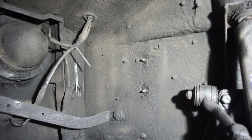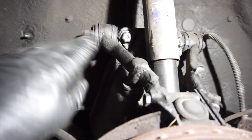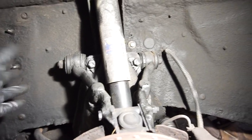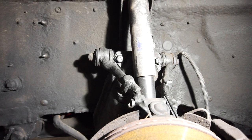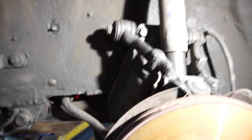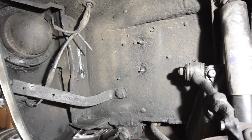It's about two hours later. I'd say it's cured — that's the right word, this stuff doesn't fully dry but it cures — so we're ready for the next coat. Everything's been sprayed in here and I've done the whole rest of the car as well. I also decided to hit some of the front suspension areas just to make it look a bit nicer. At some point I'll probably have to replace all the rubbers, take the whole front suspension out, and do a complete restoration. For now just a little rust proofing there — there was some slight surface rust in some areas but it wasn't bad at all.